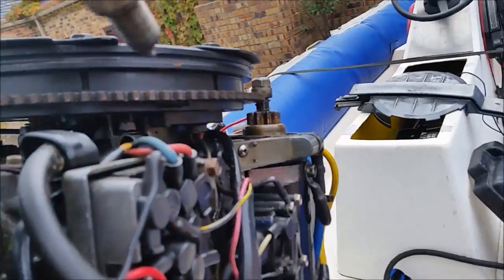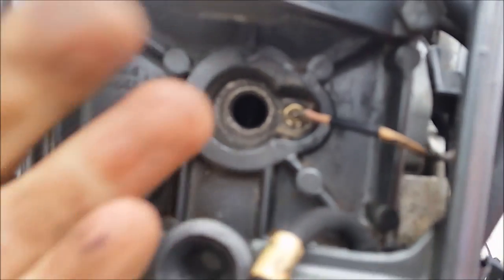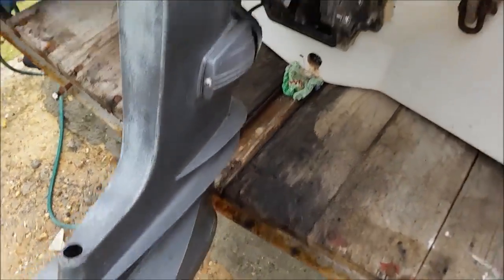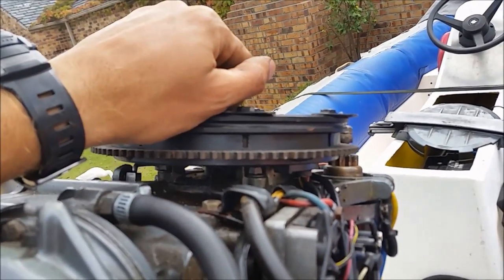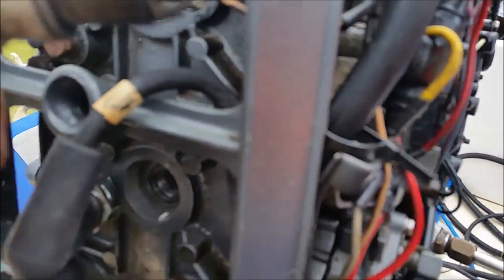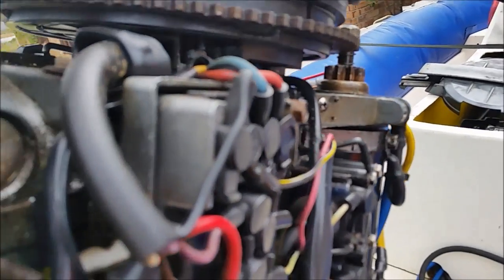Basically what you do is get your motor set up so that — if you can see down the plug hole here, I've got all of them removed — that's the piston right over there. As piston one is coming up towards the top, you want to just back it off slightly. Bear in mind you've got to have your water hooked up even if you're turning the flywheel by hand. It's very bad to have the impeller spinning on dry rubber, and it's also not good to turn this counterclockwise as your impeller can jam. So you really only want to do it as minimal as possible. What you do is screw the long thread plug in all the way — it's going to act as a piston stop. Get that all the way in, bottom it out; hand tight's fine. Now rotate your flywheel until the piston comes up and hits that plug very gently. Don't jam it in there, definitely don't use a starter — turn it very gently by hand.